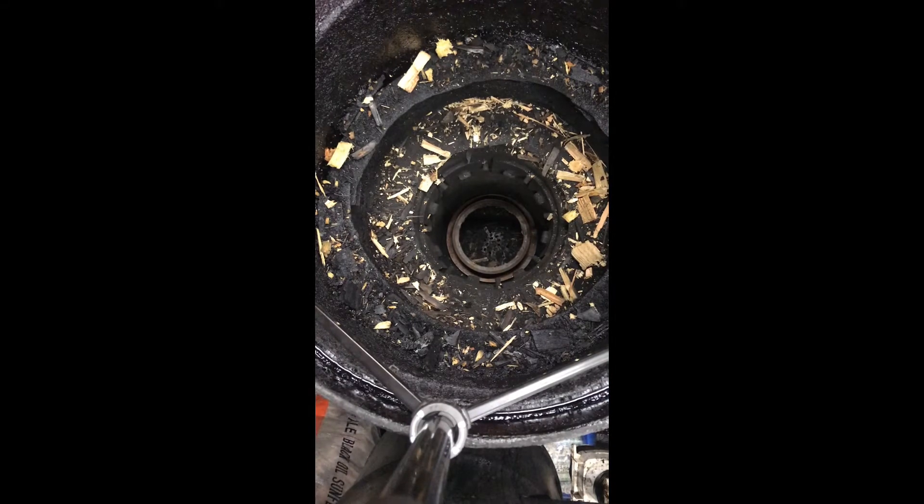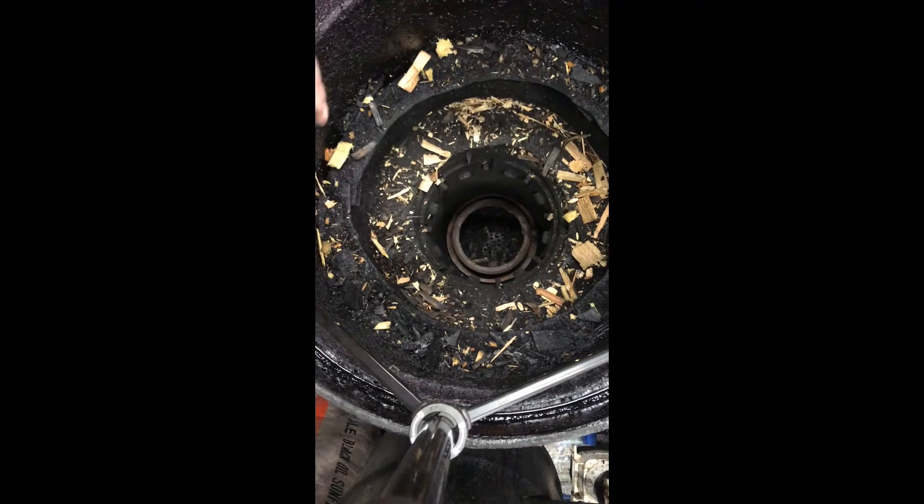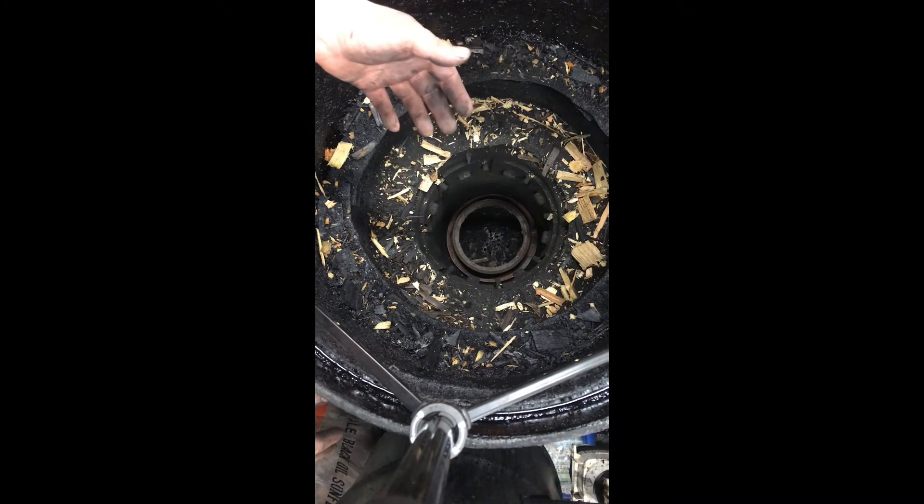Everything is part of learning and burning. My old restriction was a 7 inch, and I did just like Wayne did — just some little tabs so it sits right down in there. I've had issues holding the char bed since I put that thing in, and also lower power — I can only get it up to about 60 miles an hour. Once I get to about 60, temperatures in the rails start spiking. I've seen 650 degrees cruising at 55 miles an hour. My truck should be able to pull a 7 inch restriction if everybody in the 318 and 360 Dakotas are doing it.